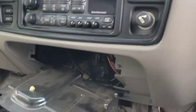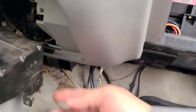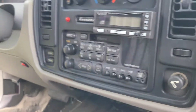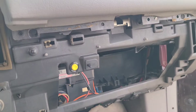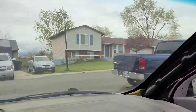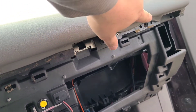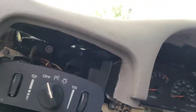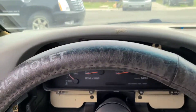There are like three screws down here — one, two, three — and then it comes off, then the ashtray, and then some screws down here in the bottom. I'm trying to be very careful because this stuff... you know. There's a bunch of panels here; I took off the ones up here, and there are these screws here — you kind of just pull this and it comes off forward. There's a screw back here for the lower part, but this is actually really easy.